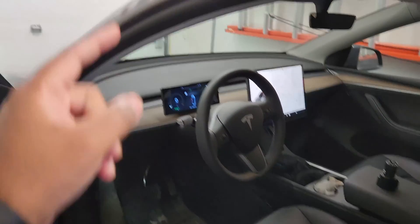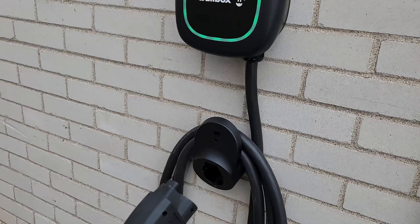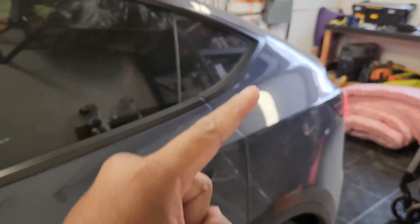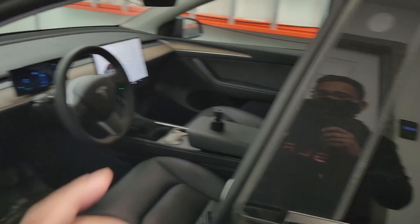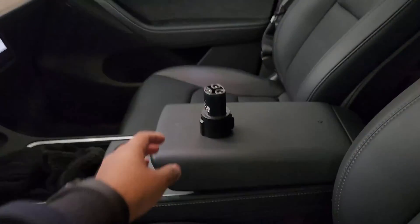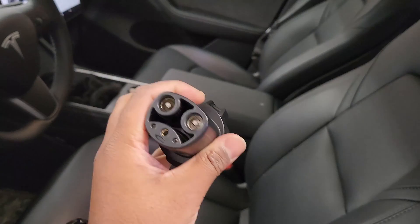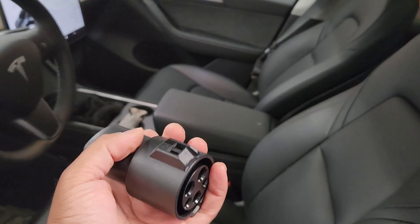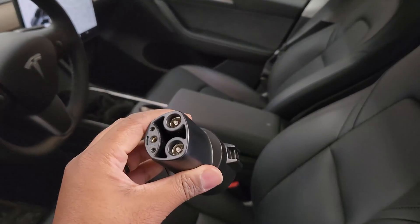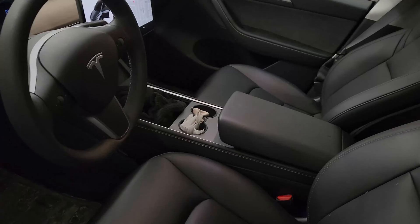One last thing I forgot to mention: the outside charger is a J1772 charger, so it does not fit the Tesla charging port. So what do I do if my Tesla is parked outside and my IONIQ is parked inside? Well, all Teslas that are delivered come with a J1772 to NACS adapter. I can plug that adapter onto the outside charger and plug my Tesla in. Either way, any car can be parked anywhere and both will be able to charge at their full amperage rate using the adapters provided or the one I bought for the IONIQ.